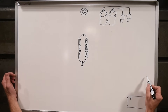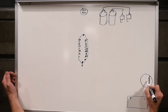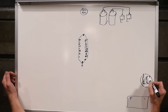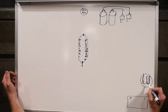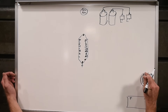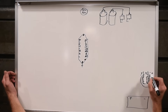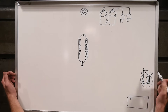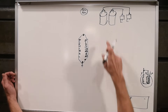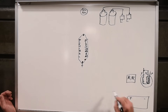Also going to need a charging system. For that I'm going to start with the stator. In the case of the Honda CB350, it's a little bit weird because it's got this old archaic format where they connect one coil when you're using the lights and disconnect it when you're not. But with modern regulator rectifiers there's no need to do this anymore, so we'll just join the white wire to the yellow — that simulates what happens in the switch when you turn the headlights on. The other part of a charging system is the regulator rectifier, and we're going to assume a combination reg-rec.